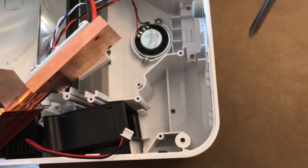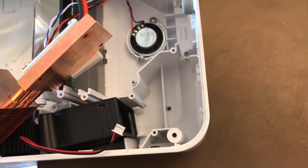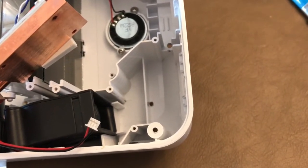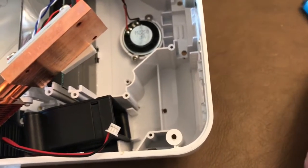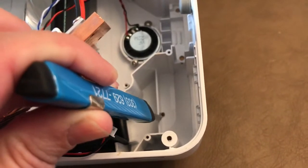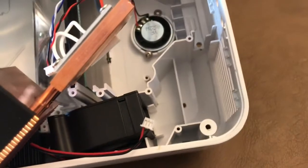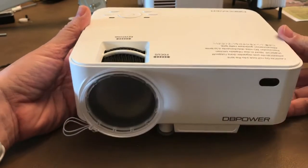You can put your screws in the location of the screw holes. The first one is down at the bottom - note that it's missing anything vital in the projector, so if you come up through the center of that foot pad it'll miss things. The fourth hole - the third hole - is right there, sitting underneath the cooling piece. Because the cooling piece sits on top of this little wall, as long as your screw doesn't go beyond about a half inch down, just use really short screws.